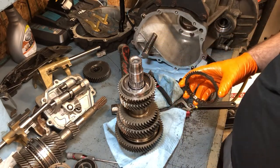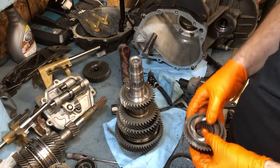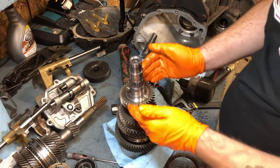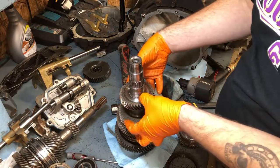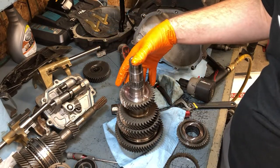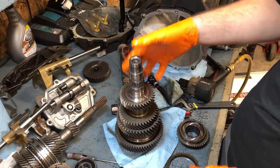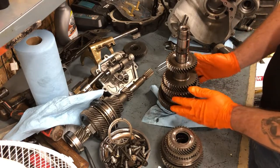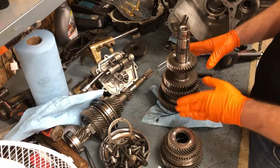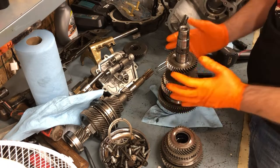The more of these I find good, the less stuff I have to buy. Then you have the gear itself — there's a needle bearing inside there, I'm just going to keep that in there. We're down to this fixture — this gear and this gear is actually one thing. I have to get this out of the way using either the press or the big three-jaw puller, because it's on a shaft spline. I looked at my service manual — there's actually a special fixture you're supposed to use, a special Chrysler shop fixture for pressing this because it wouldn't fit in the press properly.